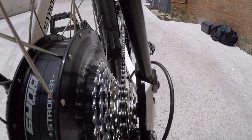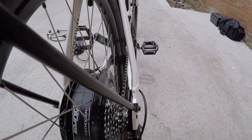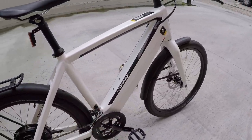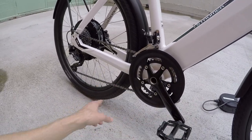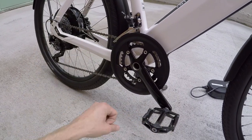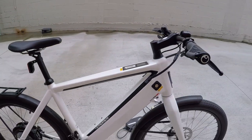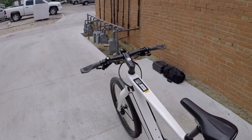This is your TMM4 torque sensor. As you push down on the pedals, it's actually sensing how hard you're pushing and responding with power output. It's not just on or off like a lot of more affordable older-style electric bikes. Those just sense whether you're moving or not. This one senses how hard you're pedaling — and you really notice it when you get on this thing. They've got cool diagnostics to show you the voltage output depending on how hard you're pushing.